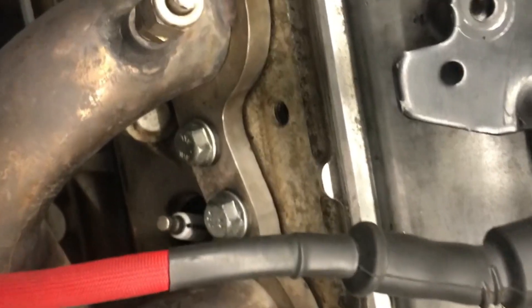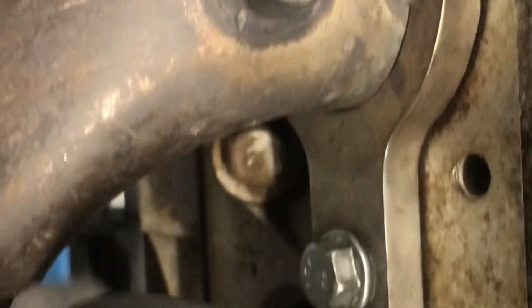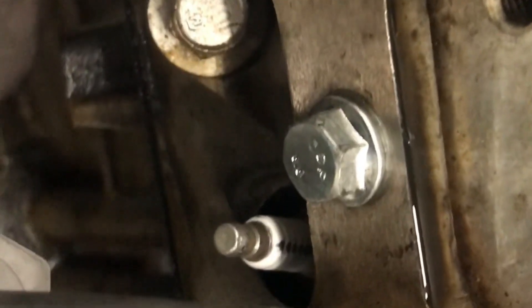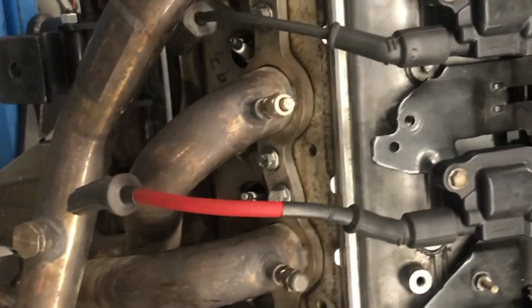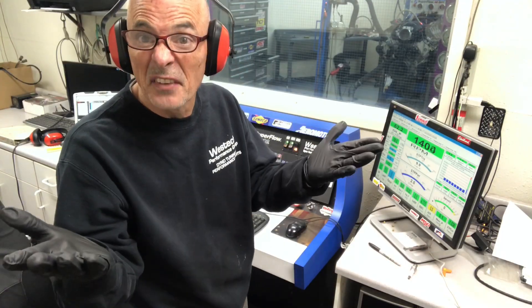Okay, one final time — fingers crossed. Using the shims, we have now readjusted our spark plugs. You can see they're all aiming in the upward direction. It's about as close as we can get to all of them being the same — they're all aiming up on both sides. Now we're going to go ahead and run it again and see if there is any change. Let's see if changing the plug index and making them all the same has any effect.